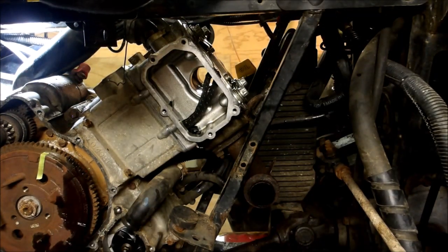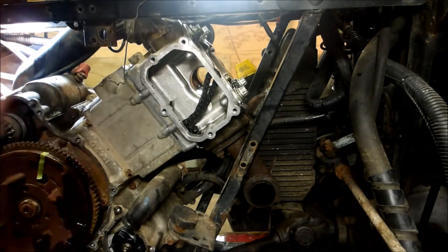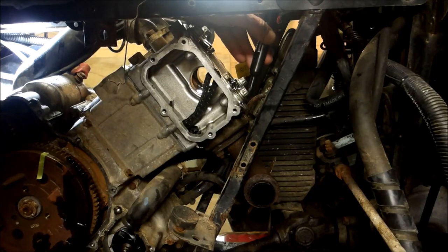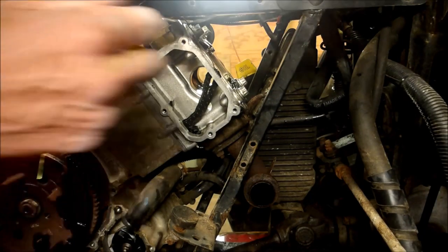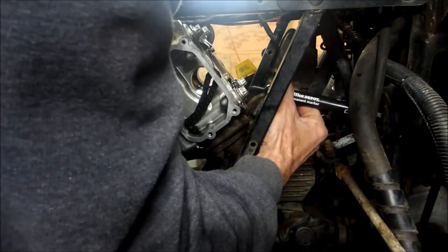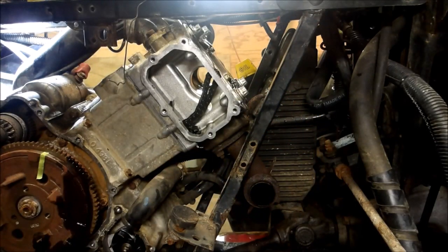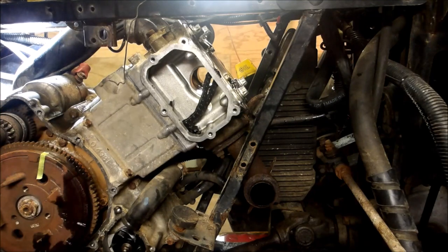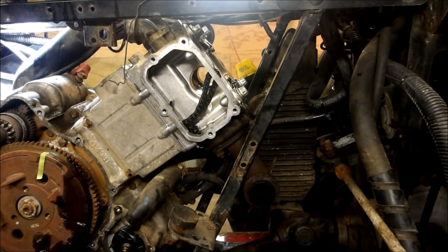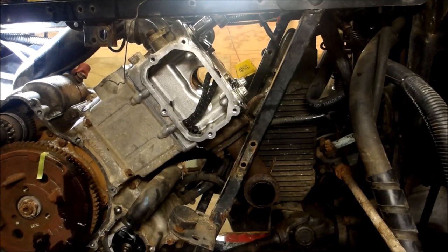What I'm gonna do is put a mark on each one of the bolts on the top only, because the torque sequence is very weird for Polaris. You torque it down to 22 foot-pounds first, then 51 foot-pounds, and then after that you have to back it off and tighten it a quarter turn — I'll kind of go through everything.